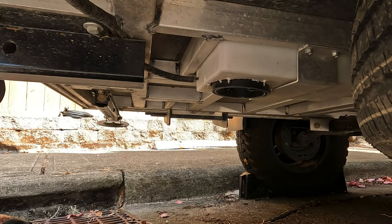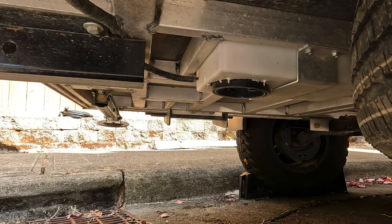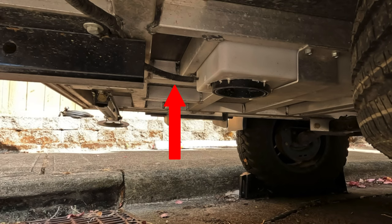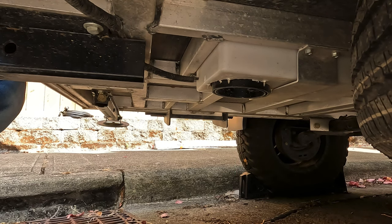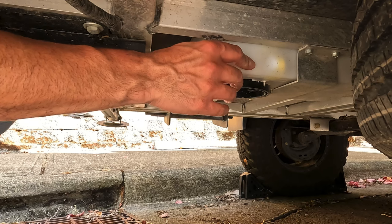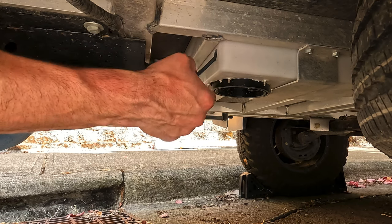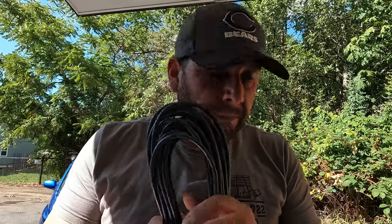After cleaning up inside it was time to move back outside under the camper. You can see the bottom of the old battery well — it's been a handy way to get things into the interior without drilling into the sides of the camper. You can see the power cables running to the diesel heater plug and the four-inch marine hatch I installed for the diesel heater hose. I was hoping the existing diesel cable hole would be big enough for the Starlink and XT60 cables, but it was not, so I drilled another hole on the opposite side, feathering the impact to make a hole just big enough for the cable heads. Eventually I'd like to seal these holes better as they allow some dust intrusion.